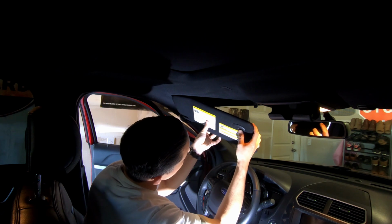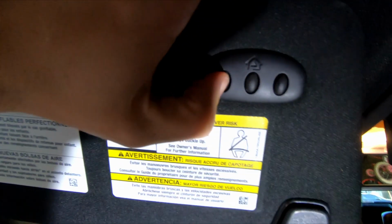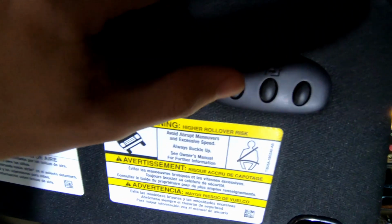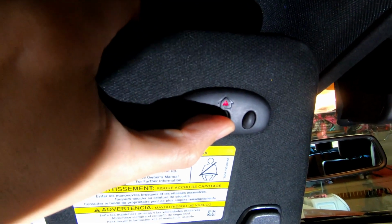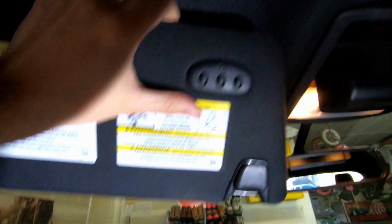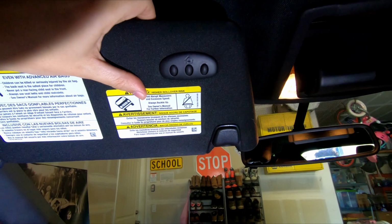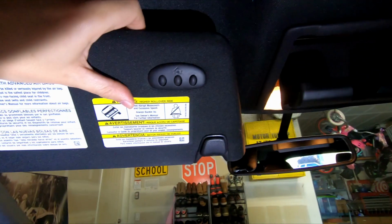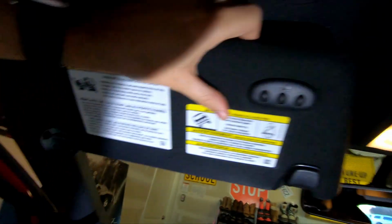Okay, so this still had something programmed in it at one point. So that's interesting. I don't know if you can see this, I'll try to hold this up. But with these Homelink systems, how you know it has an active code is the rapid flashing. And then the slow flashing means that there's nothing stored. What's kind of interesting is this has been unplugged, and I got this off of eBay. It's been unplugged with no power, presumably, and it still has the code. So that's kind of cool. If you ever have to change your battery on your car, you don't have to worry about losing your programming. So we'll have to clear that, but I'm going to button all this up and then we'll clear it.